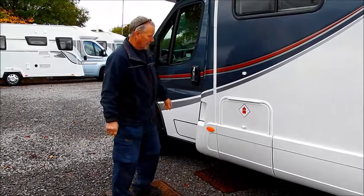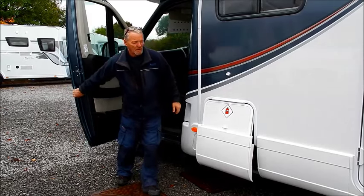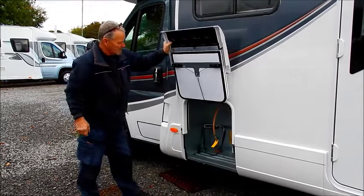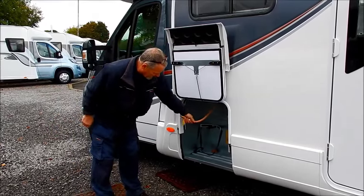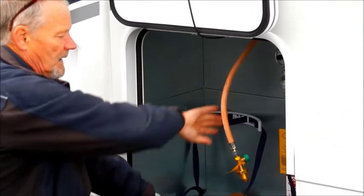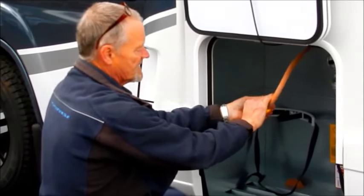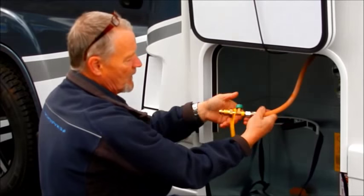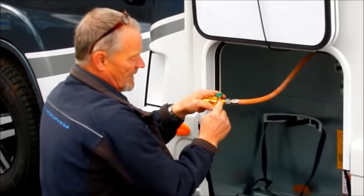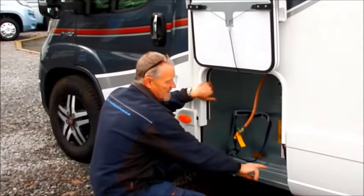The LPG gas locker — liquid petroleum gas. The catch for this particular model is just inside; pull the lever and it unlocks. Inside in the middle you've got what we call the pigtail, which is a connector to the gas bottle. You're going to need at least one gas bottle — normally you'd have two. The main thing to remember when you connect to the gas bottles is that it's a left-hand thread, so you need a spanner or a shifting wrench. Tighten it up, turn the gas bottle on, then press the green button at least once — there's a valve inside here so that if there was an accident and that pipe was severed, the valve kicks in and stops the flow of gas from the bottle. There's room for two bottles: either two 6kg, or you could have a 13kg and a 6kg.